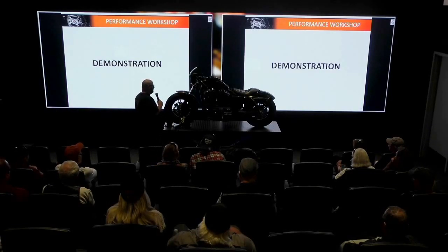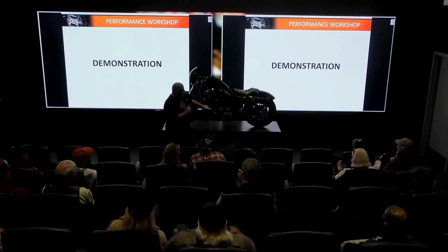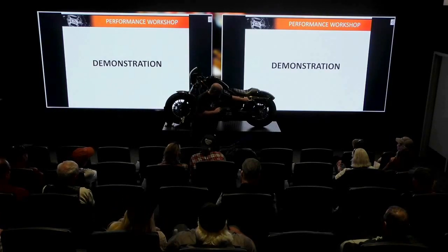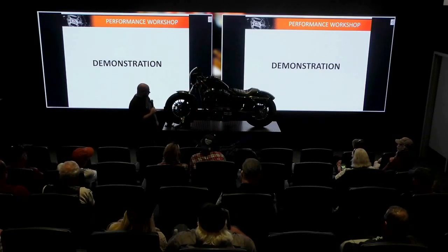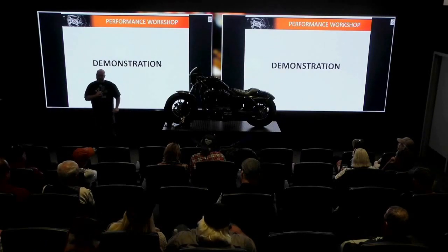New on the Sportster this year was a bigger front end. It's a 49-millimeter front end over the 39-millimeter front ends before. So it makes it handle a lot better. Also, they have the new premium ride emulsion shocks, and those are stock on these now. They're not an option, so way better than the old stock shocks were. I misspoke. And that's it. Does anyone have any questions about it?